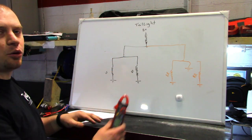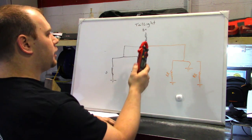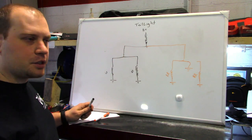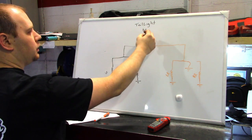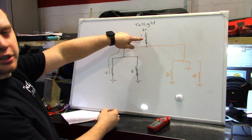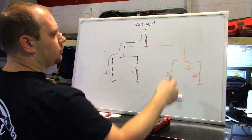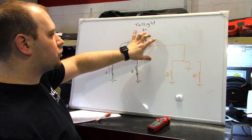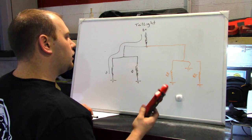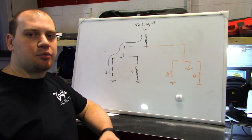The plan to figure out which leg of the circuit is shorted is to use an amp clamp. Right at the fuse box I have two wires coming out. I'll put my amp clamp on each leg and measure the amperage. We know from basic electrical that higher resistance means lower amperage. So if current comes down through this circuit through a bulb, you have two resistors on that leg — lower amperage. But on the shorted side, power goes straight to ground, so you'll measure higher amperage. Whichever side has the higher amperage most likely has the short.